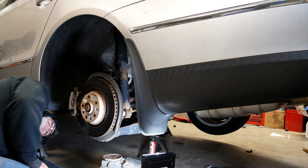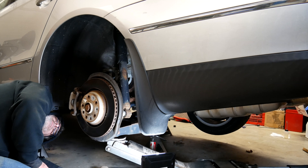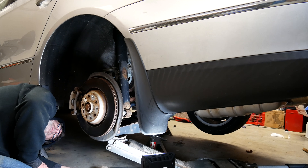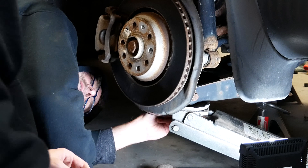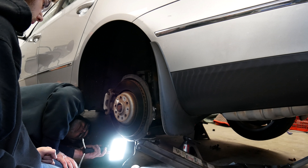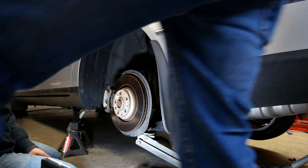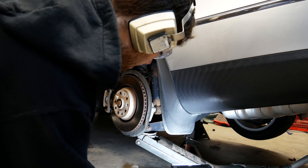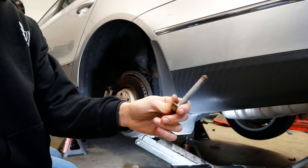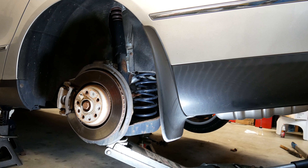The reason that you want to be extra careful here is that the suspension arm is under a lot of energy from that spring right now and it's extremely spring loaded. If you take the bolt out without anything under it, it's going to fire down and could cause a lot of damage to you and the car. As you can see here I carefully took the nut off making sure that the suspension bolt was not backing out, and then I used a jack to put some pressure on the suspension arm. You'll need to look at the bolt to see if it's lined up straight with the hole as it comes out — if it's lined up nicely this means you have the proper amount of pressure from the jack. If it gets crooked you need to put more or less pressure with the jack. Once the bolt is all the way out it's time to lower down your suspension arm in a nice controlled fashion.